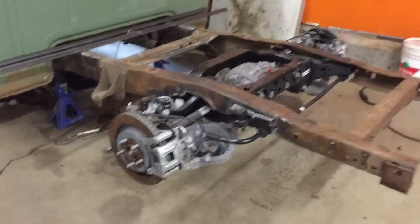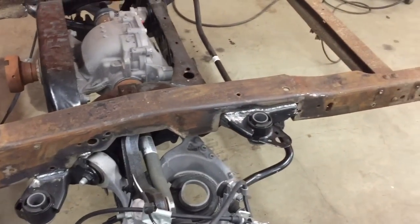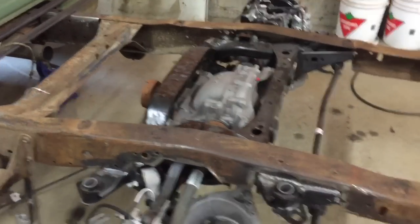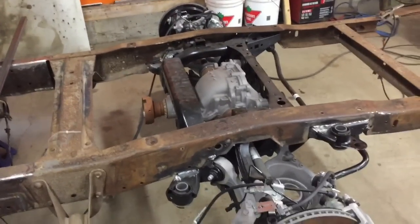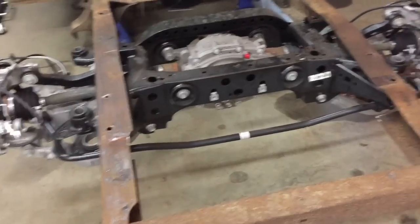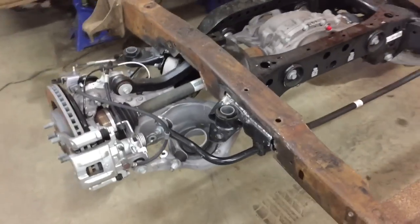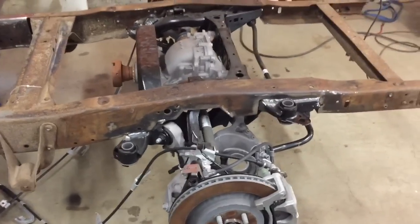Okay, there it is. It's hanging on its own. Got a few beads welded on there — I don't want to get it too hot and twist anything up, but it's coming together nicely. I'm pretty happy with how it welds. Just got a whole bunch more welding, boxing, and plating to do. But there it is — a 2017 Mustang Independent Rear Suspension in a 1971 F100. Next up after I get this done, it's going to be on to the gas tank, which I'm moving into the back using a '70 Mustang fuel tank. A little concerned that the sway bar and the very rear of the subframe might get in my way, but we'll find out as I go. I'll keep filming these videos. If people keep watching, you can like and subscribe to my channel. I appreciate that. Until next time, thank you.